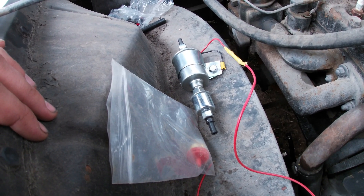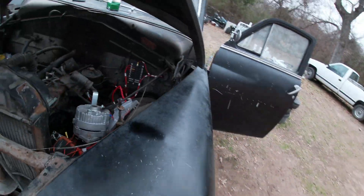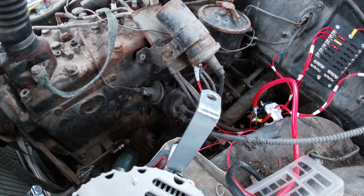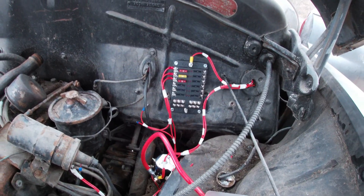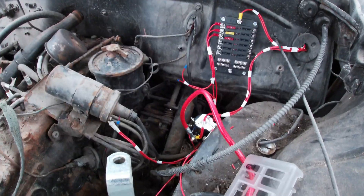That's it. If you want to rewire one of these cars, start there. It's going to make it a lot easier than buying a giant painless kit that has all these wires for a horn, relays, headlights, and radio. Just get the car to where it's kind of modernized and where you can add stuff as you go — get it wired up, fired up and going.